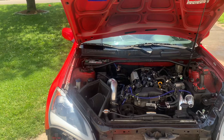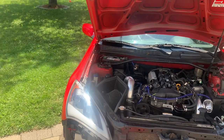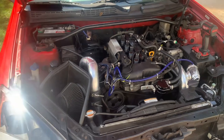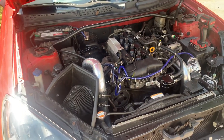What you want to do is just take off your hot side and cooler piping, just so you have all the room so you're not fighting around anything, and your intake. Usually the first step would honestly be just to drain the cooling system, but mine's already empty.